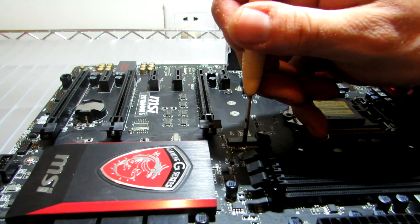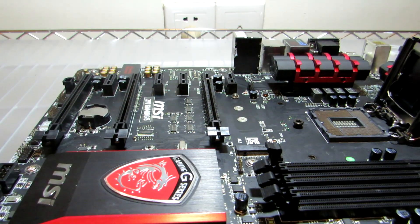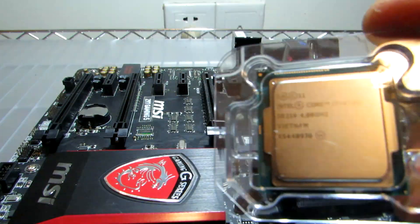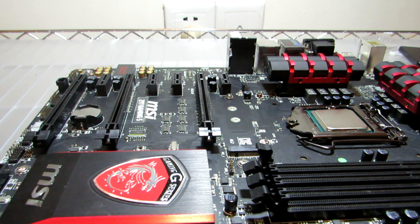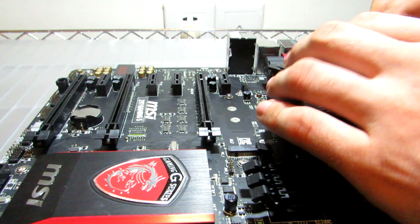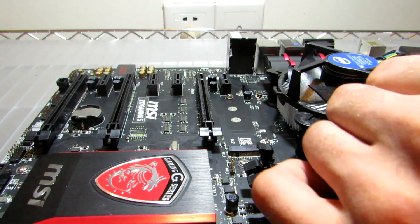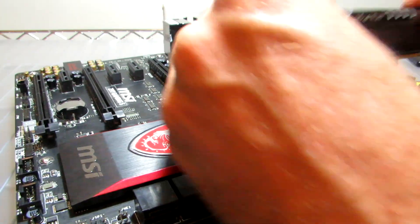That's the last screw, so now we're all done — got the motherboard screwed in, it's in solid. Put the CPU in, got an i7 4790K here. You can use a cheaper CPU if you're just mining with the GPUs, but I wanted a CPU so that I could try CPU mining some things also — multi-purpose. I'm going to put on the heat sink. I'll probably change it to a better heat sink later if I want to try and overclock and mine with an overclocked CPU. For now I'm just going to mount this on there — there we go, it's on. Plug it in. Now I'll put my DDR3 memory in.